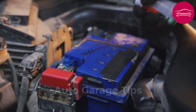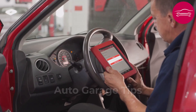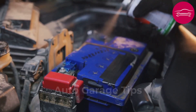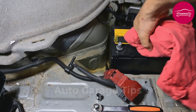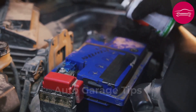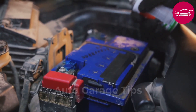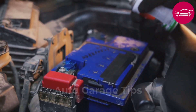Number 9: Thoroughly clean battery terminals with baking soda. This solution solves 80% of unexplained electrical failures. Battery terminals accumulate a whitish layer of sulfate that acts as an electrical insulator, progressively blocking current flow and causing erratic symptoms. Always disconnect the negative terminal first to avoid short circuits and wear protective gloves. Prepare a paste with baking soda and a few drops of water, then rub vigorously on terminals and posts. The chemical reaction neutralizes acid and dissolves corrosion instantly. Rinse abundantly with clear water and dry perfectly before reconnecting in reverse order.